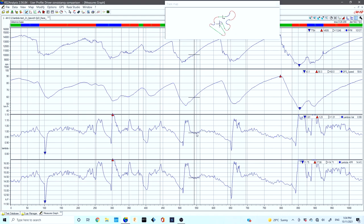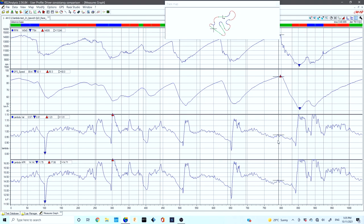We want to see it around the magic zone on the straights — which is the easiest to measure — between 0.93 and 1.00. Here at the top of the straight we can see we're still holding a lambda of 98 even though the squiggly line is starting to move down. Then it changes when we shut the throttle and start applying the brakes. Checking another straight, we've got 1.00 or 14.54 AFR. At the top of the next straight this engine is in pretty good tune at 97 and 14.14. So what you're aiming for is that magic lambda of 93 to 97 — you can run as lean as 1.00 or 1.05 if you like, but these are the numbers we aim for on our tracks.